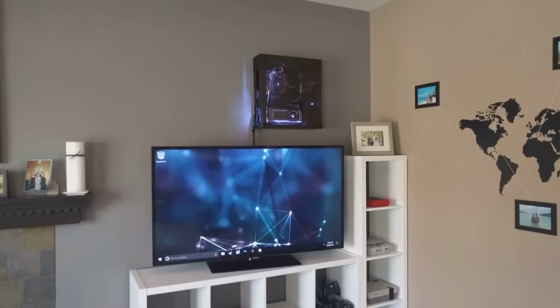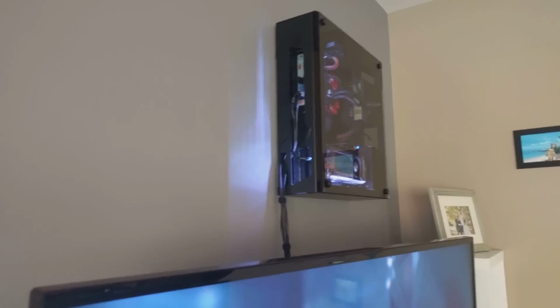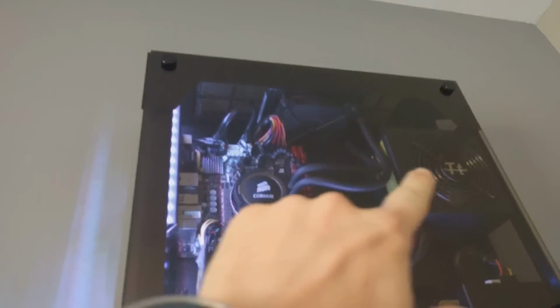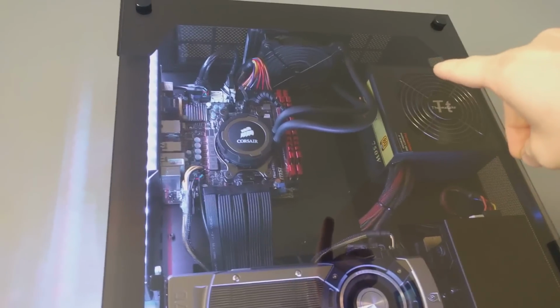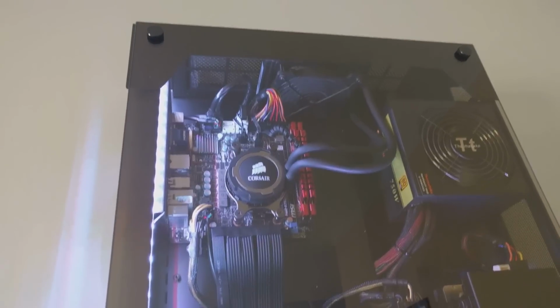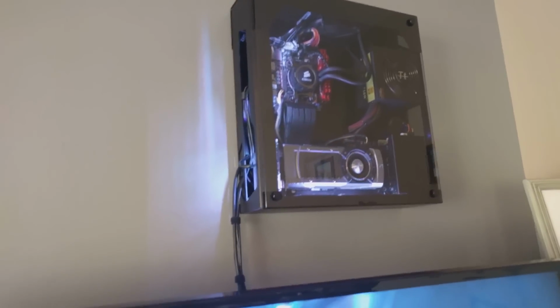As we discussed during the build, the shortcoming was the power supply cable hitting the radiator. We ended up, as you can see right there, removing all the fans along the top, unfortunately, and just keeping the radiator in the center. Down the road, we could potentially put a 90-degree plug for the power and then squeeze the radiator above the PSU and add another fan, because the radiator would bump the other fans. Other than that, it's a great build.